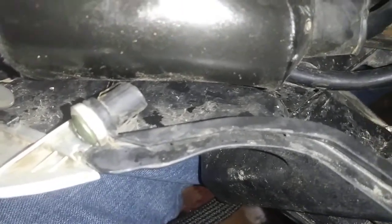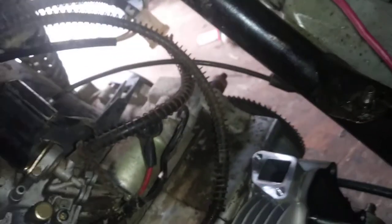Don't worry, that sound is just the pinion gear — you can see it whenever I move it, rubbing up against it, that's what that sound is. The only reason I have that side off is because I'm replacing a main seal on that side. The main seal on this side doesn't look bad, but I've got to replace my magneto too.